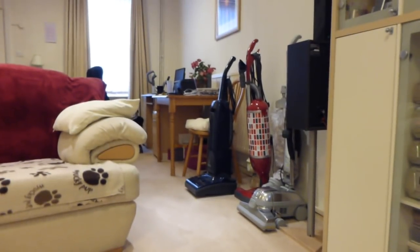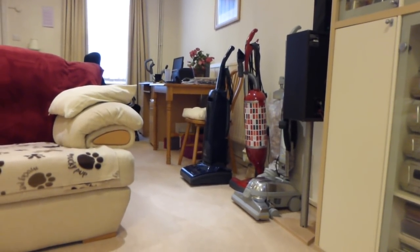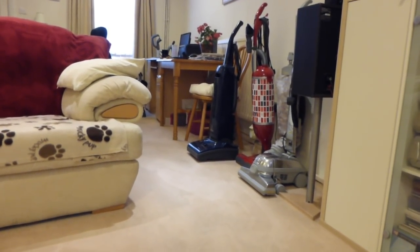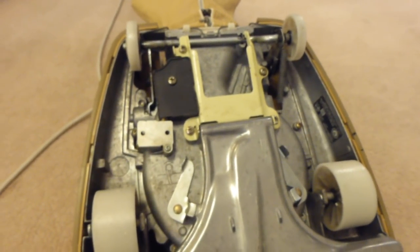You've got certain appliances, certain vacuums like the Sebo there, which has got a lifetime toothed belt on, so you don't need to worry about them. They don't stretch. They're not stretch belts. They're toothed belts. So you can leave them on permanently because it doesn't damage them. But where it's a stretch belt like this, it's important to store them with them off.